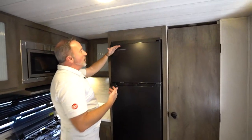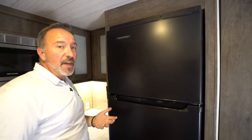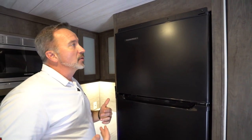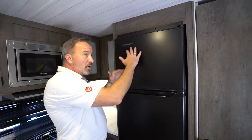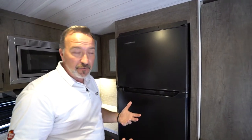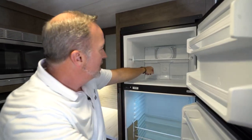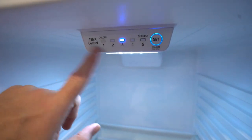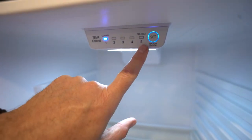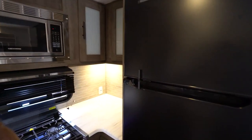Your Forest River Salem is also going to come with an Everchill 12-volt fridge. This is a frost-free refrigerator that runs off 12 volt, which means it can run off the house batteries. Since you are solar prepped on this one with a 10-amp quick connect on the campsite, get some solar panels — they come in so handy. They'll trickle charge the battery because these 12-volt fridges will pull a lot of power. They cool things down a lot faster than gas-electric fridges, because the gas-electric fridge is really just meant to keep things cold, not make them cold. It's 10.7 cubic feet. To cut it on and off, just hold the control for 10 seconds. If you need to store it while in transit, there's a safety latch right there.